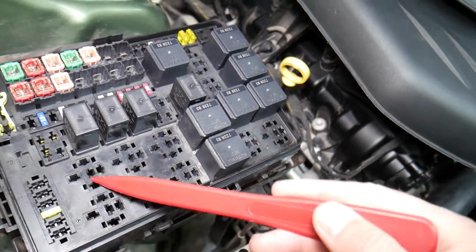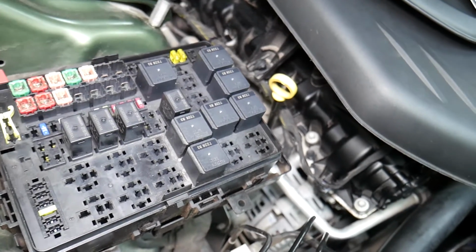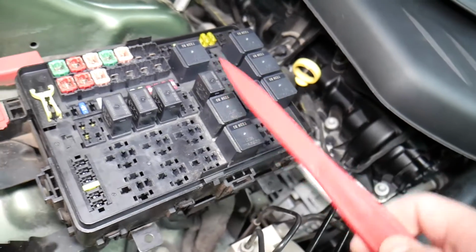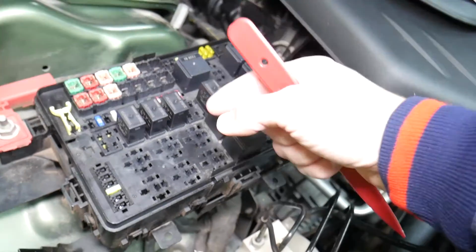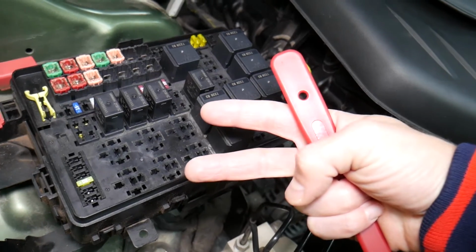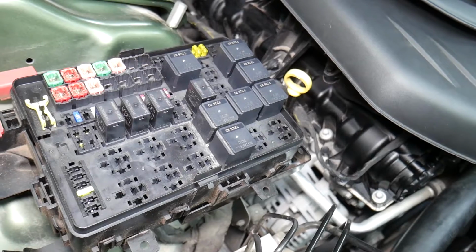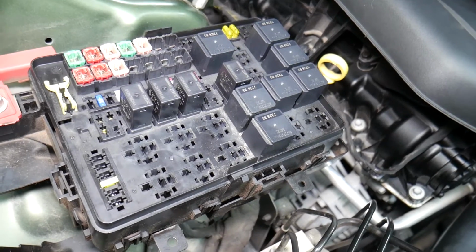And for some certain fuses, it's important to disconnect the car battery when removing them, otherwise you can burn the electronics. For instance, when working on airbag fuses or anything like that, you need to wait at least 1 hour after disconnecting the car battery. And if you're not qualified and certified to work on the airbag system, I will never recommend to do that. But when disconnecting the car battery, a common mistake people make, it's important to know which battery terminal you reconnect first. If you do it the wrong way, you can burn electronics modules. How do we know about that? We burned before the traction control module on a BMW that cost us $2,000. So we'll put a link in the description of the video below on which battery terminal to disconnect first. Check it out for your convenience.